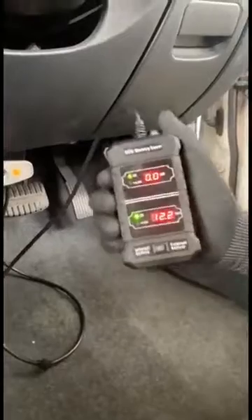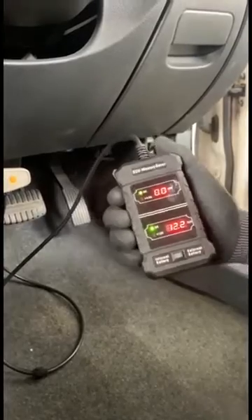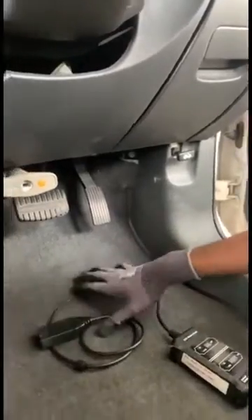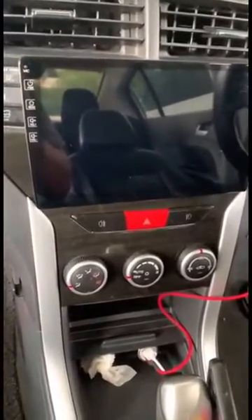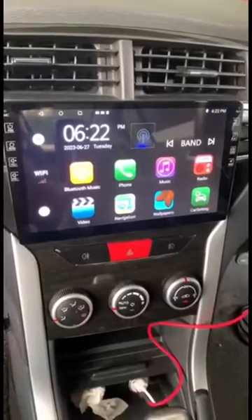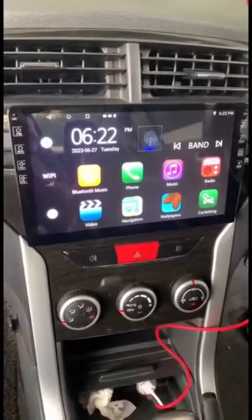The reading is all steady and the car battery replacement is done. The next step is to disconnect the device connection from the DLC of the car. After that, we can check if the car memory has been saved. Before turning the ignition key on, make sure the DLC is safely disconnected. You can see the clock time remains the same — if there were any changes in the time, that would indicate changes in the memory.